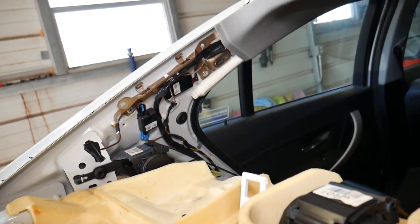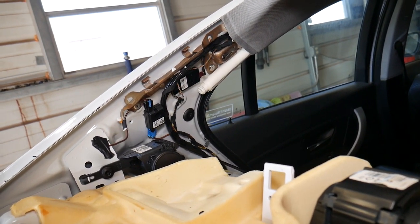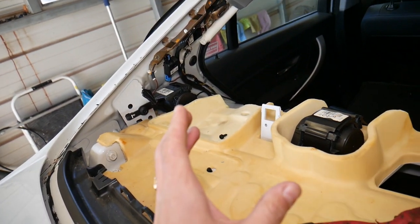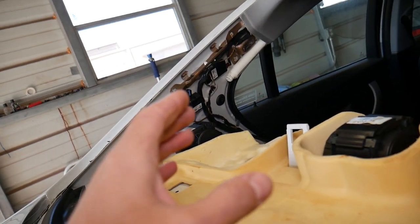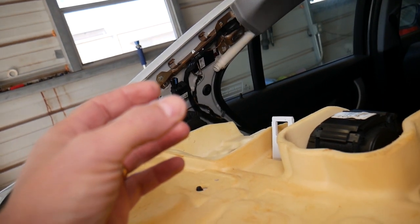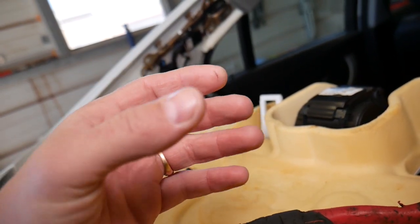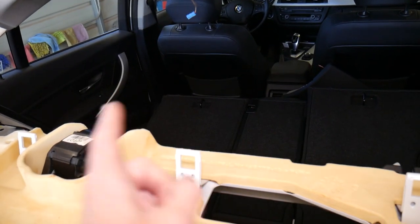You have a device — or capacitor — somewhere in your car that is going to actually cancel that noise and static through filtration. Otherwise, every time the spark plugs ignite, they create a kind of magnetic field. Spark plugs, fuel injectors — all of that, when activated, creates interference, and as a result you will hear it through your door speakers.